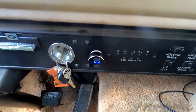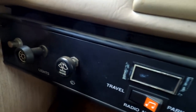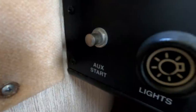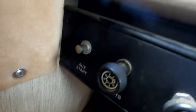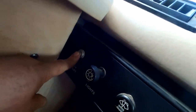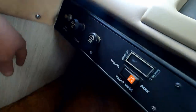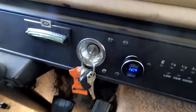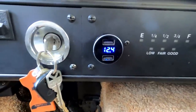Way over here on the left side of the dashboard, beside the wipers and the lights in the corner, is this auxiliary start button. On the Tiffin it said 'emergency start' and was a different type of switch. You just push it in while you're trying to start it — it doesn't stay. You push it in and it's borrowing power, then you start it up and release it. So naturally our voltage jumped up a little — it says 12.4 but it'll drop back down, it won't hold that for very long.